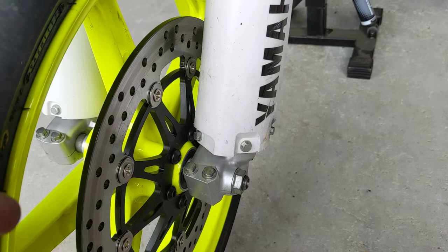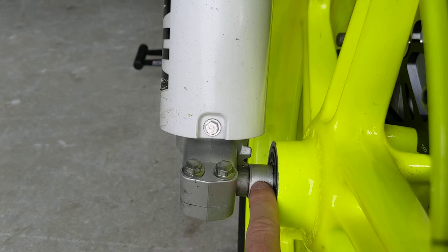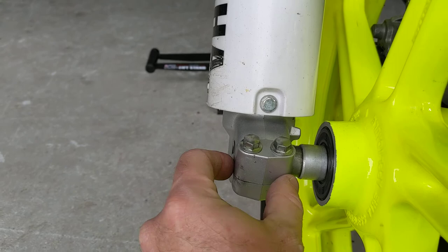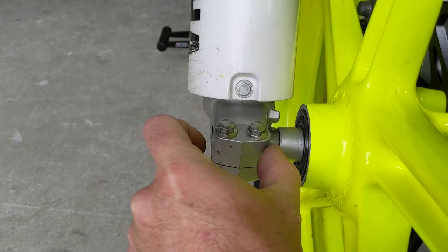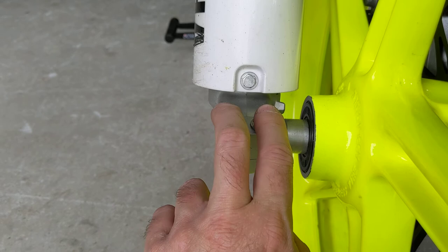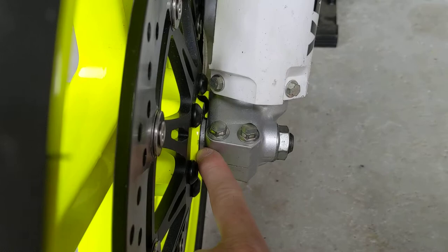The critical spacer is the one on the disc side — that sets the wheel into center, because the axle bolts the wheel against that spacer into the fork leg. The non-disc-side spacer is less critical because the shoulder on the axle pushes that spacer in. The idea is: put the axle in, do it up tight, leave the clamps loose, bounce the front suspension to let everything settle so the fork tubes don't bind, then nip them up. That non-disc spacer could poke out a couple of millimeters and it wouldn't be a big deal — it just looks nicer if it's flush. Build the inside spacer on the disc side, check it's centered, adjust or cut a new one until it's right, then cut the other one without being too picky.